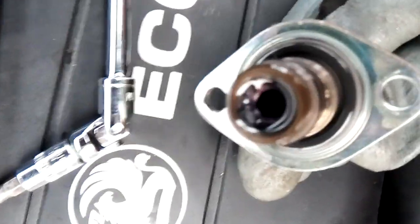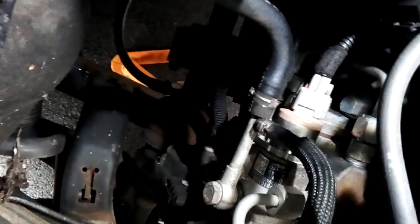There we go. That's the new suction control valve in place now. We've tightened it up again — the bolts weren't mega tight, so I've just nipped it closed. What we'll do is we'll do a start-up, make sure that it's all okay, and then we'll check to make sure that there's no leaks from the fuel system, just to be absolutely sure, because we want to make sure that there's nothing leaking or any problems that we've caused ourselves.